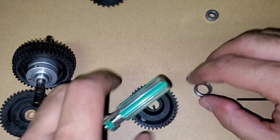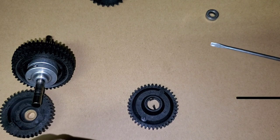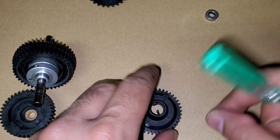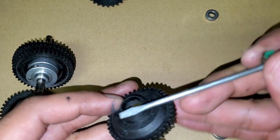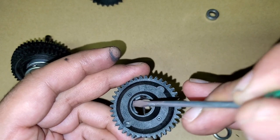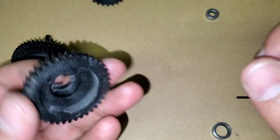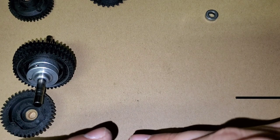I'm back and I got it out — sometimes a little brute force goes a long way. It looks like it didn't damage anything, just a little piece of debris. Since this gear was already toast with the cam being stripped, I took my screwdriver, placed it on the little ridge on the inside of the gear, and banged on the end of the screwdriver with a heavy mallet. Did one side, then the other, and it popped that bearing right out. The bearing looks to be in good shape.